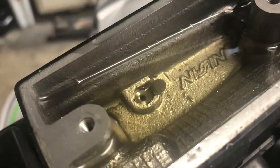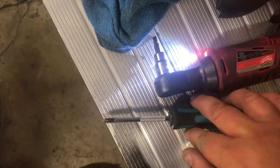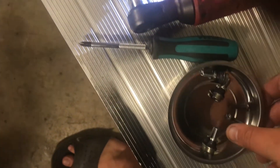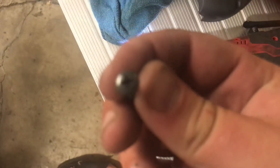We can put that back together. We topped off the reservoir — make sure it's good to go, nice clear fluid. Look at that tab — you want to make sure that tab is in the right spot. And we put it back together. Really simple job. All you need is a five millimeter Allen socket and a JIS screwdriver to do the top of the master cylinder. These are really soft screws and if you don't use JIS, they'll strip out.